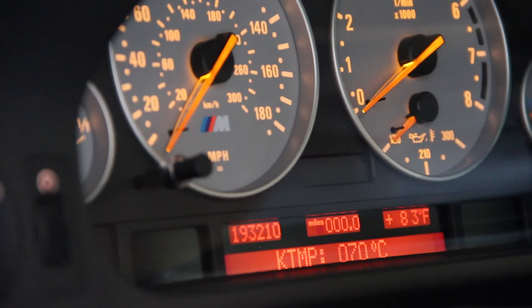If your car were overheating, the temperature would rise steadily above 79, maybe up to 100 degrees Celsius. If your thermostat is stuck open and not functioning properly, your coolant may never even reach 70 degrees. This is much more accurate than looking at the needle. The E39 M5 does not have a buffered needle, so a difference of a degree will actually move the needle — it's not always exactly at 12 o'clock. If you have a 523, 528, 525, 530, 535, or 540, that needle spends the majority of its life at exactly 12 o'clock because it's buffered — it has a range that reads as 12 o'clock, versus this car which has one specific temperature at 12 o'clock.